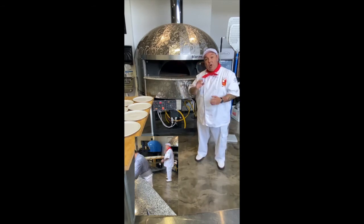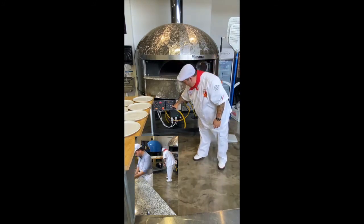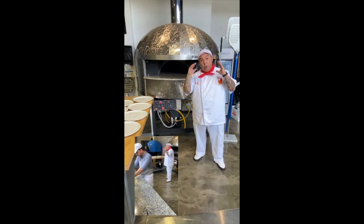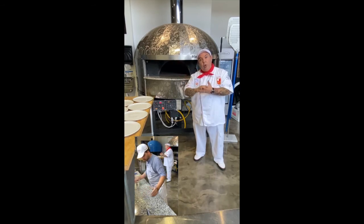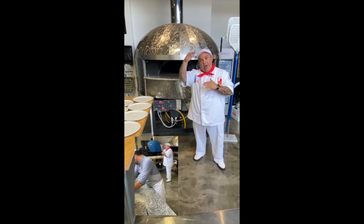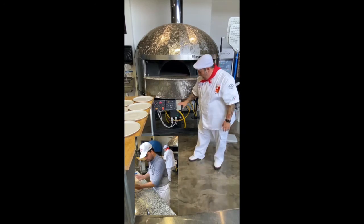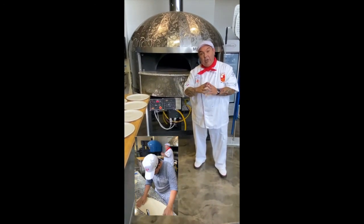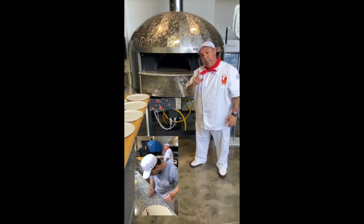Besides, this oven also has a gas burner, which is adjustable. This has an automatic setting right here. You can see that the light is flashing. So we can either set this to constant mode where the fire is going and the gas burner is firing by itself automatically, or we can do it in manual mode where you actually program the height, or trim up and lower the flame itself. Now, in this case, this oven right now knows that I have a set point at 575 degrees, and it's cut the gas so it's all the way at 1, its lowest setting on the burner.